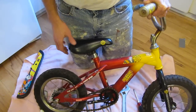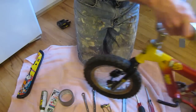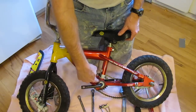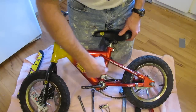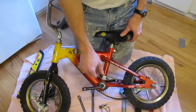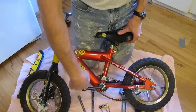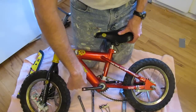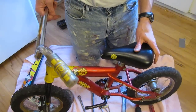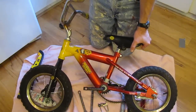The first thing I'm going to do is turn the bike around. One important word of warning: on the non-chain side of the bike — that is, the left side — all the bolts are threaded in reverse. Manufacturers do this so the pedals and cranks don't loosen while riding. So when you want to tighten, you turn counterclockwise, and to loosen, you turn clockwise. The same is true for the pedals — on the left pedal, to remove it, you turn it clockwise.